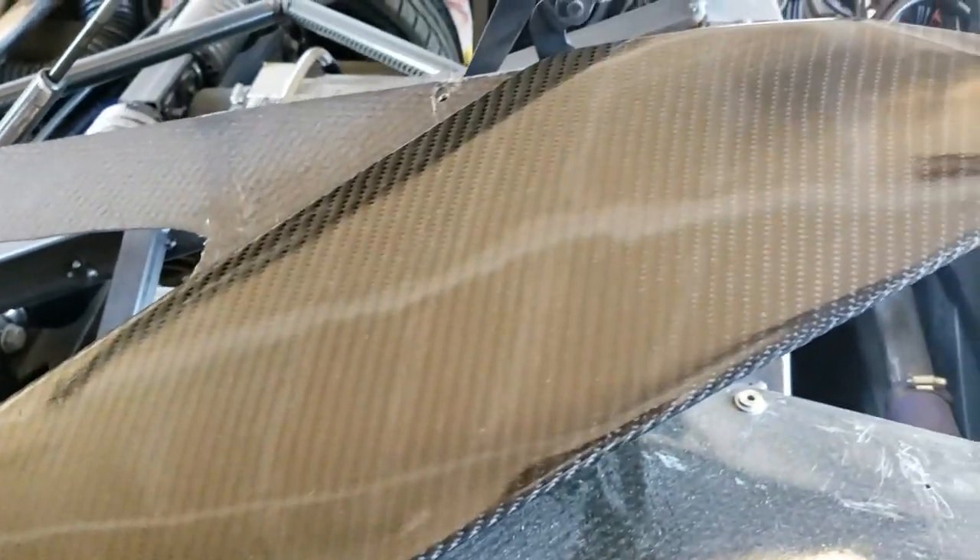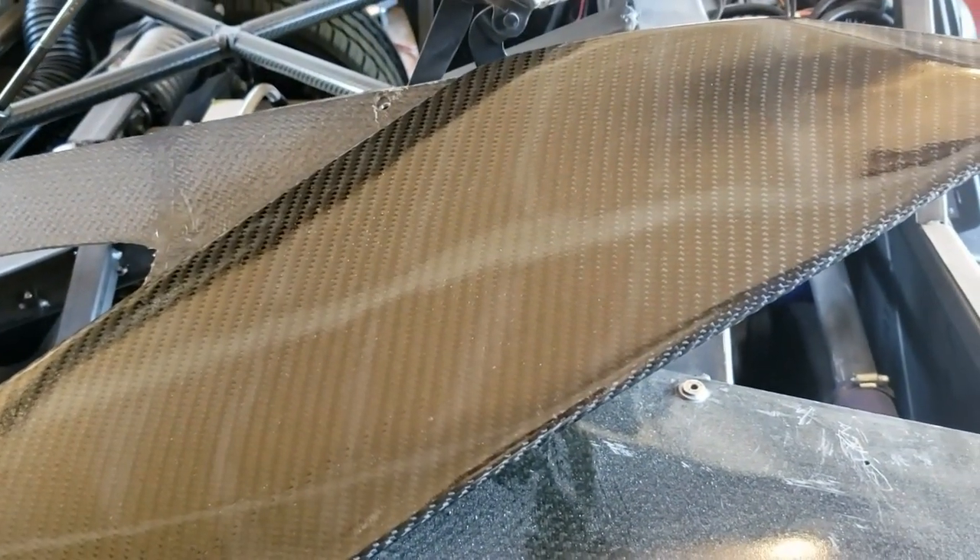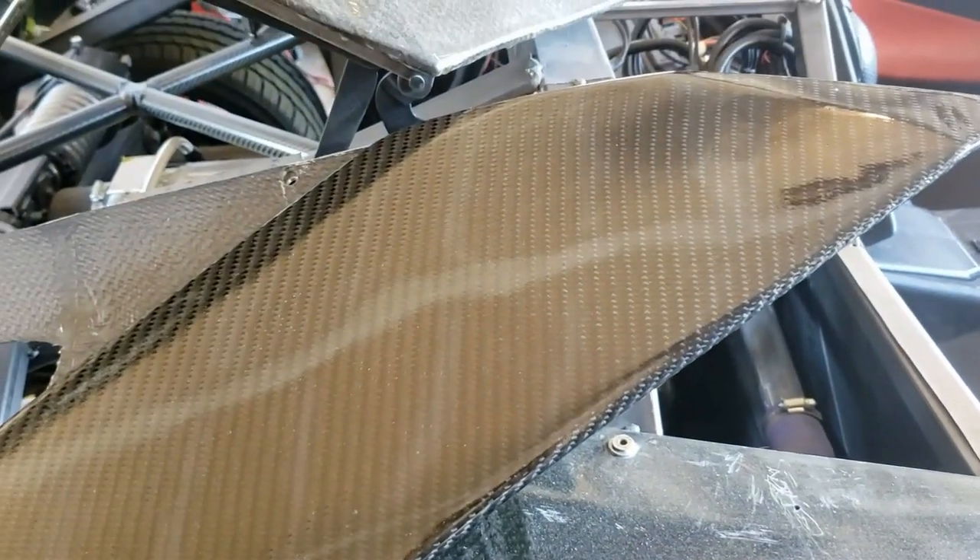My only complaint is you can see some of those little bubbles in there, and that's probably why in the future we'll go ahead and paint the car so we can get it perfectly smooth and get those bubbles out. I did use a heat gun to try to get the bubbles out, but I think the mistake was that instead of using infusion epoxy, I used thin epoxy, and it doesn't wet the carbon fiber as well as the infusion stuff. As it's sinking in, it causes some bubbles to come out. We'll address that and try to do more panels with that capability.